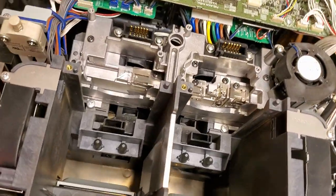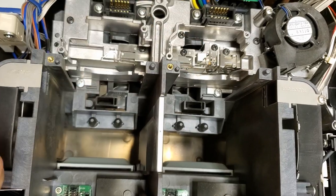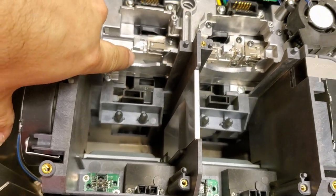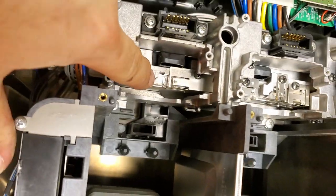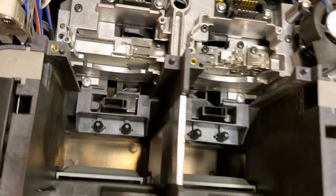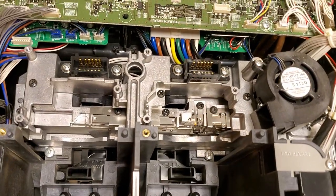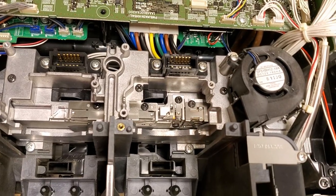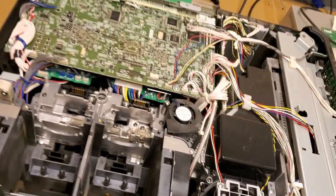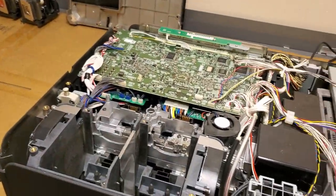This is where the lamps go. They go in there, and then their light shines into the color wheels, and then in through that little, there you go, you can see it better through this piece of glass right here, and conversely that piece of glass, and then those are where it feeds into the rest of the projector, as far as I know. That's what it seems like, at least. Anybody knows different, please say so, but that would essentially be the light tunnel for this model.